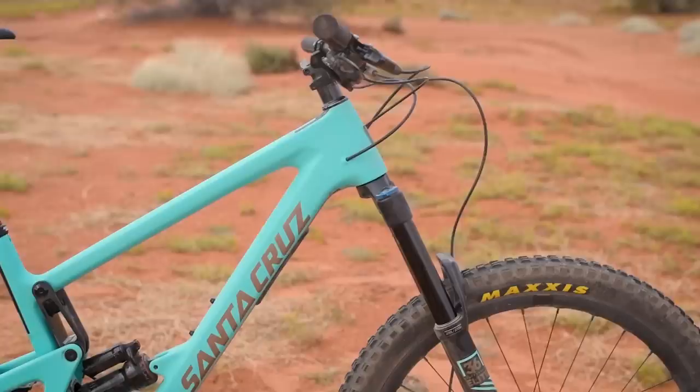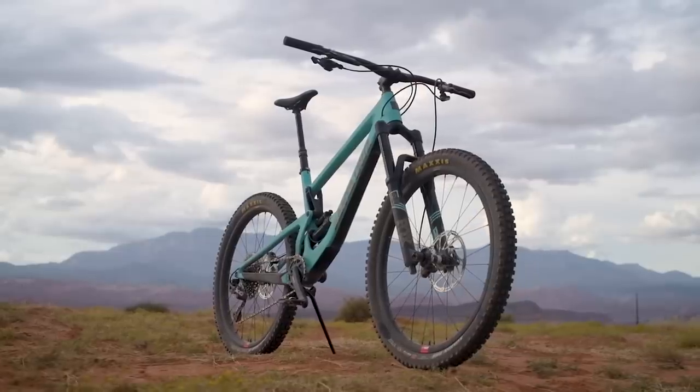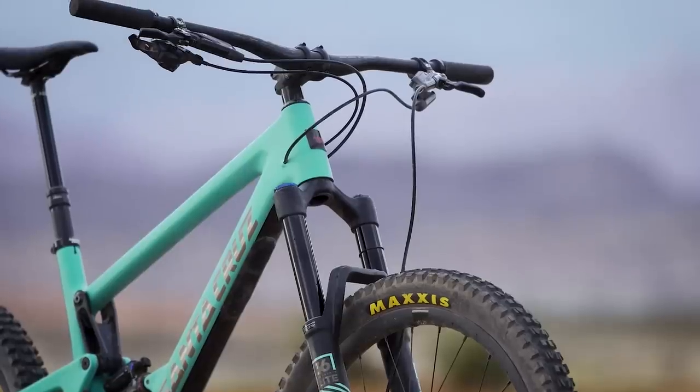Like a DW link has that sort of hover-bike effect where it just reads through the terrain really well. I definitely noticed some shortcomings on the ledgier climbs. It has a fairly slack head tube, which made it feel less easy to pop over rocks on the way up — it really wanted that front wheel to stay on the ground, which can be a good or bad thing depending on your style. That said, I was perfectly happy going uphill. It felt pretty efficient, the seat tube is reasonably steep, and I didn't feel like I was on an inefficient big enduro bike on the climbs.